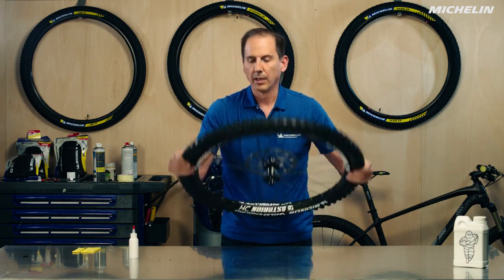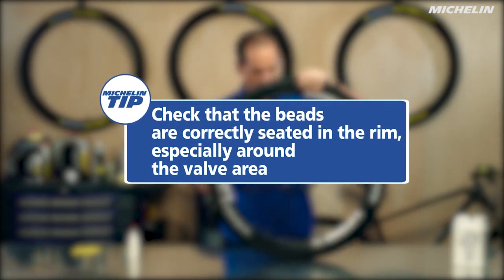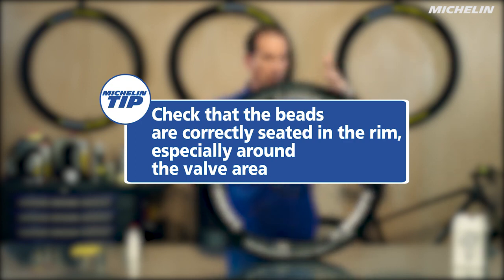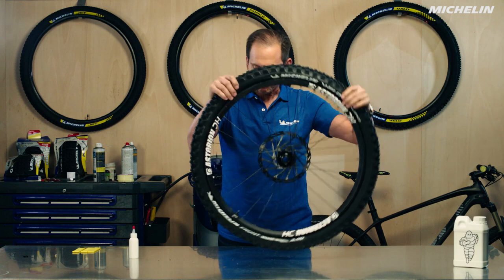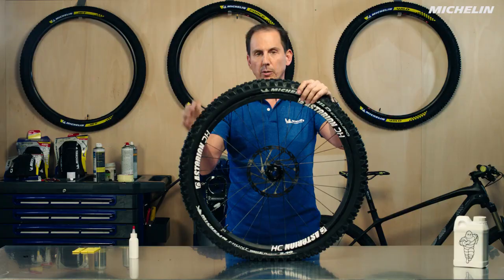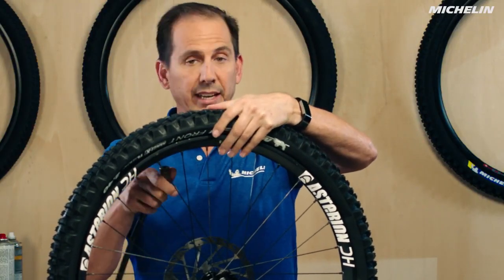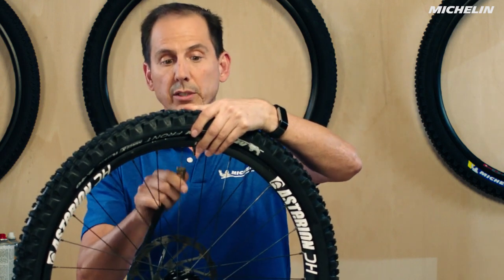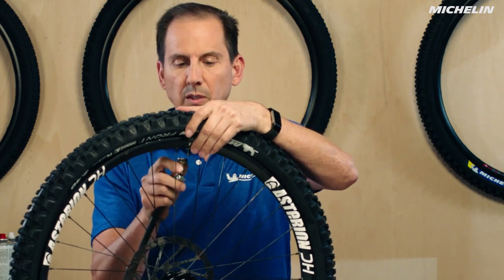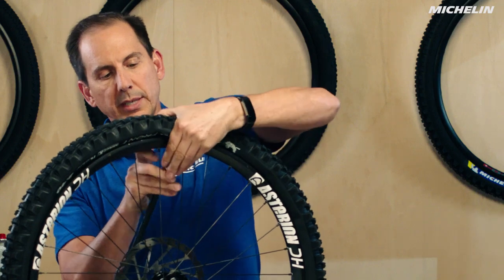Now I want to make sure the tire is centered pretty well. If the tire is centered and the rim and tire are well made, it's really going to facilitate adding air to get the tire seated correctly. Since we've removed our valve core, the compressor chuck is not going to hold on to the valve as it would if the valve core were still in there, so when you add that on make sure you hold it in place as you pump it up.